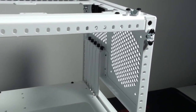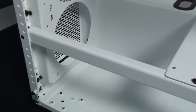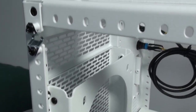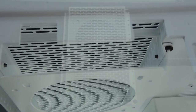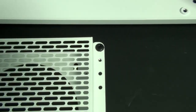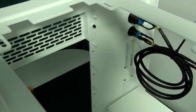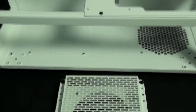Looking at the inside of the front panel, you can see the accessory for mounting a 240 millimeter radiator and fans. It's designed for the fans to be mounted between the ventilated panel and the inner panel, and then the radiator on the inside. This can be dismantled - there are six screws holding it together - and it needs to be dismantled for the fans and radiator to be mounted, because they need to be mounted from the front side and the ventilated panel is in the way. The 5.25-inch bay design is excellent: there are little rods that stick out and everything that mounts into the 5.25-inch bays fits onto these rods.